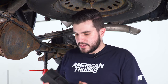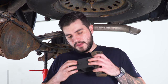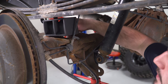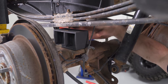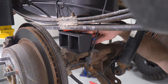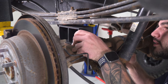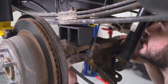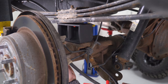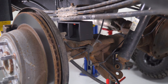When you install the new block, it goes in a certain way. Looking at it from the side, one end is a little bit narrower than the other — that tapered, narrow end is gonna be toward the front and the knob is gonna be on the bottom. Slide the lift block in with the tapered side facing forward toward the front of the truck. Make sure it seats into the little divot on the mount. The knob on the bottom of the leaf spring will seat into the open hole at the top of the lift block. Keep an eye on that and start lifting up on the pole jack. You can move the axle back and forth to manipulate where it seats to make sure it's sitting correctly. Once it locks in, jack it up — and repeat on the exact opposite side.